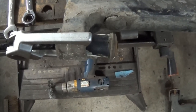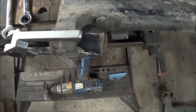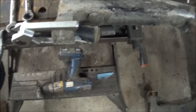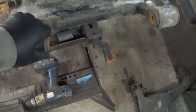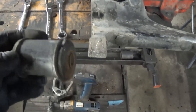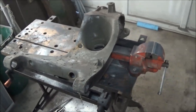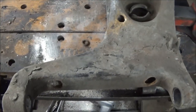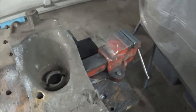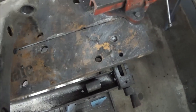Real-time bushing removal — better if I had my right hand on the wrench since I'm not left-handed. We're just going to pull that out by hand now. There we go — actually not in that bad of shape. These trailing arms were originally sand cast, so when you pull the plugs out, if they've never been out before, there's usually a pretty big amount of sand still left inside, along with some degradation of the aluminum. Let's tip it up and see what we get — should probably have a mask on.